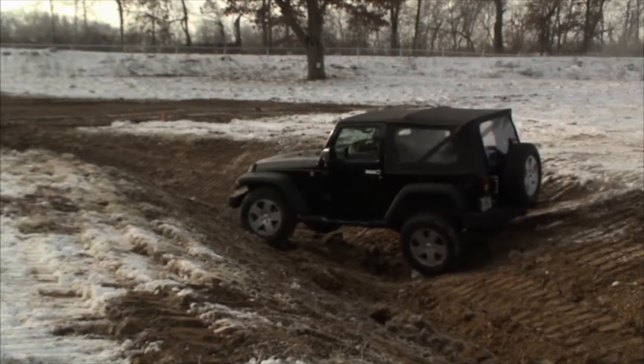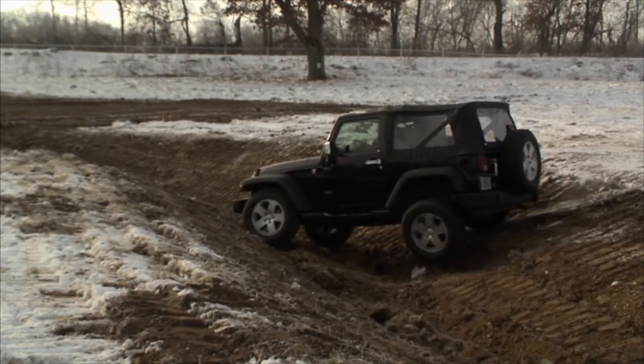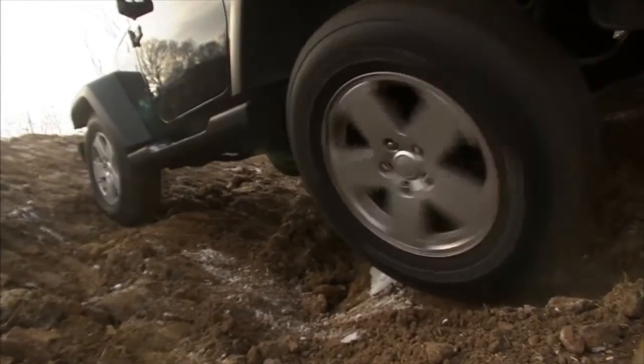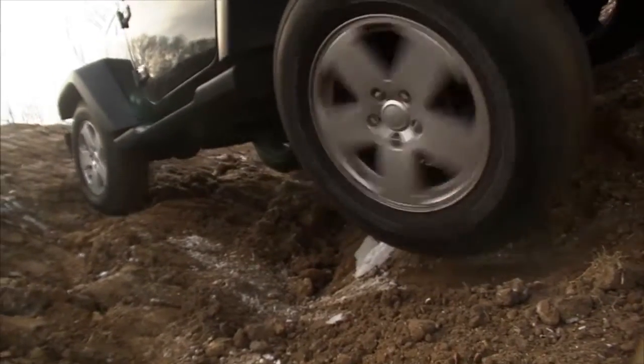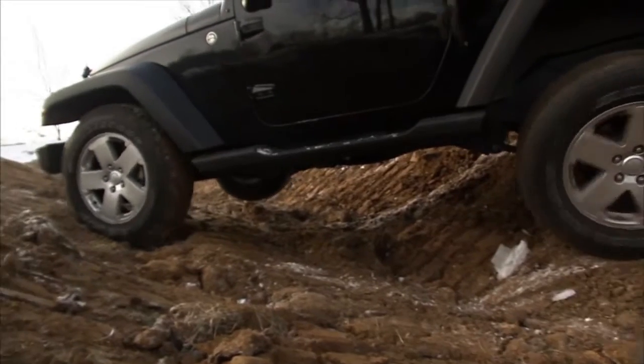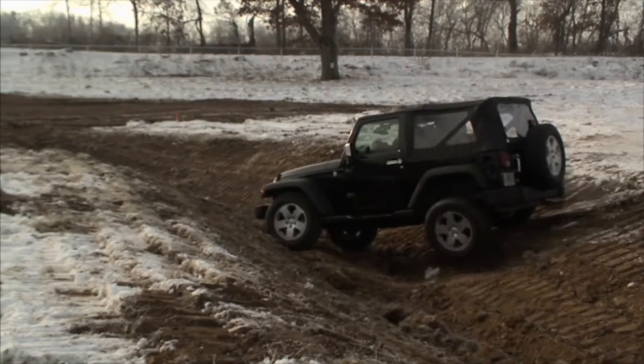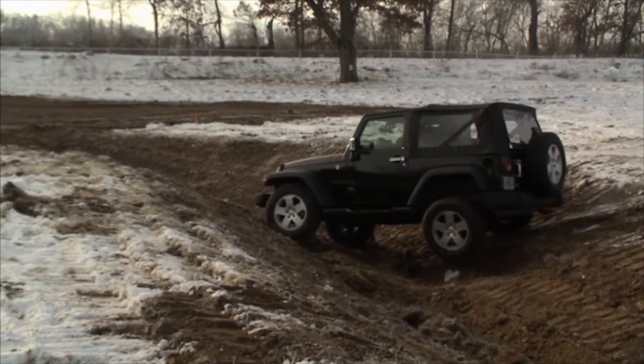And we're seeing exactly that here, because as the vehicle is centered across this V-shaped cross section, we've got one wheel on the front axle that has great traction, but yet on the opposite side, it has no traction. Right. And then we have the same situation on the rear wheel. All my power goes to the wheel with the least amount of traction. And that's why we sit in that feature and spin our wheels.